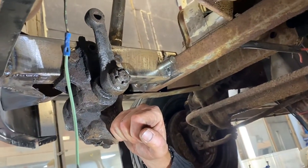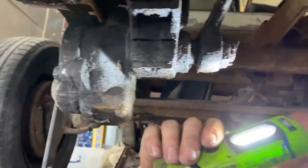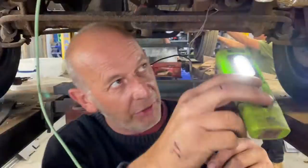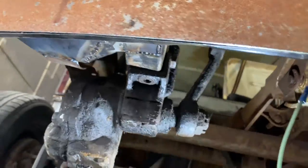I've got the new old steering box in. So you're actually just nicking the bolts off that one as well? I'm nicking all the bits off of that. I'm just reinforcing the front under here, because obviously the front panel is very slightly different. You can see this one's got the extra piece tying the extra chassis section in. I've just put that in on that side, done the same thing, mirrored it again, and fully welded it in.